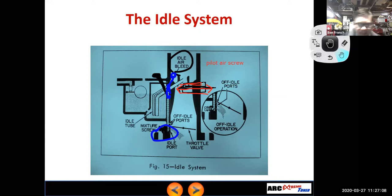And what usually happens again is that you lose low speed drivability, but you gain high speed performance. In fact, I think that's one of the things that really hurts our little RX-7, is that it probably is too restricted by the Venturi area of the carburetor. Anyways, regarding the motorcycle carburetors and the Holleys and their idle mixture.